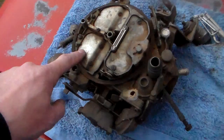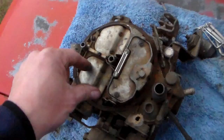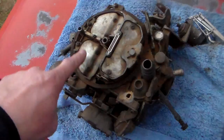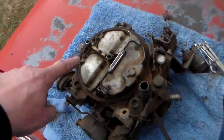Now if you're dead set against running this damper - if you just can't bring yourself to use it - then you can tighten the spring up enough that the doors probably won't flop open, but they will be very tight and that's not how you're supposed to do it. You really need to run all of this. I know it seems like voodoo and maybe the backyard mechanic in you says you don't need this, but you do. Rochester knew what they were doing - this is off of a Trans Am carburetor, so they weren't blowing smoke.